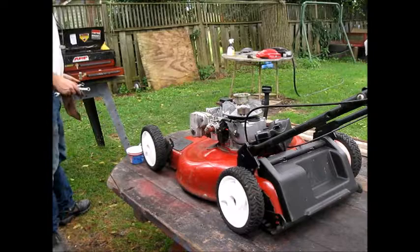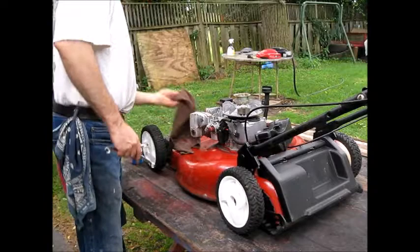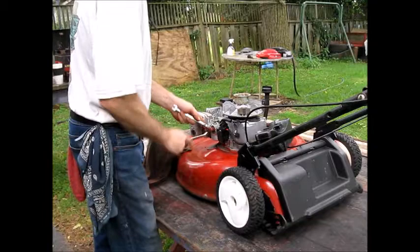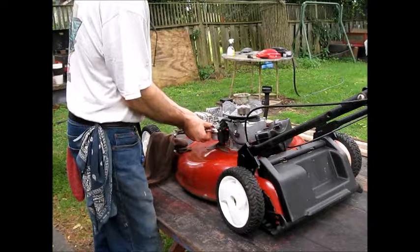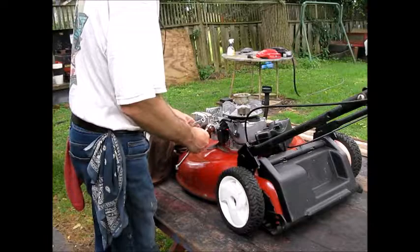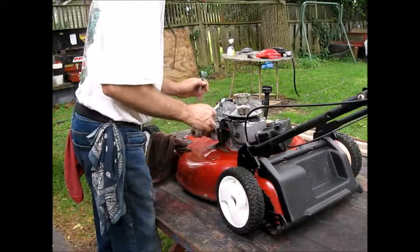So, blew a little bit of juice in here. We'll blow more juice into that. Get to it real easy. Yeah, might be able to do it. With nothing on the top, it certainly should be a lot easier. Just a couple of bolts here. It's always a good idea when you're down this far to clean the fuel tank, clean out the carburetor, clean your magnets. Clean this. Check it. Put it up on the bench. Test it. Now this is where it's always a pain.